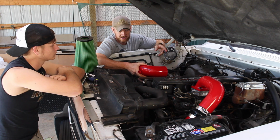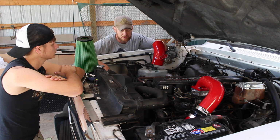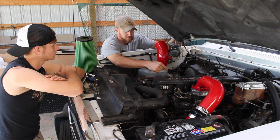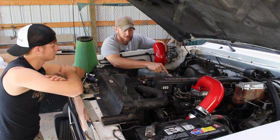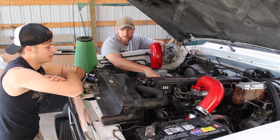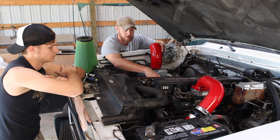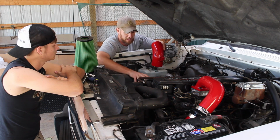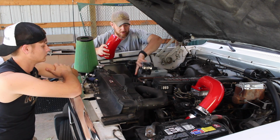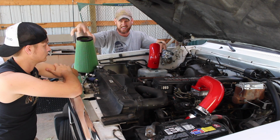And I like what you had here, because some guys have the factory one, which is longer, and I understand why they're doing that, because you have the cold air intake that's right down below there. But the thing is that we want to give as much cold air to the turbo as quickly as possible. I've seen some rigs where they'll just have a filter connected right to the turbo. And then I see some guys also who don't even put a filter on. But I'd like to have a filter on there, and so I like this system better than any of the other ones that I've seen so far, just because it is shorter. It gets things away, around the alternator, so that we're not plugging up, because we don't have enough room between the turbo and the alternator for a decent filter.